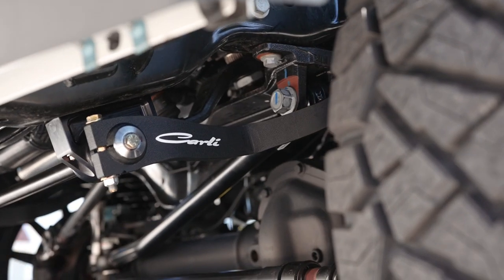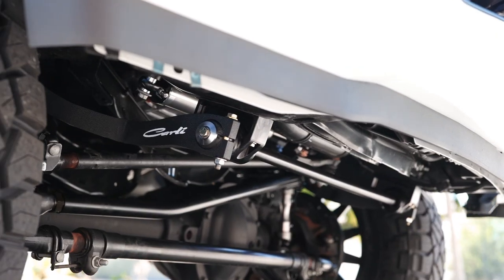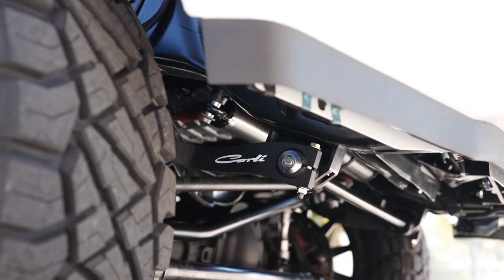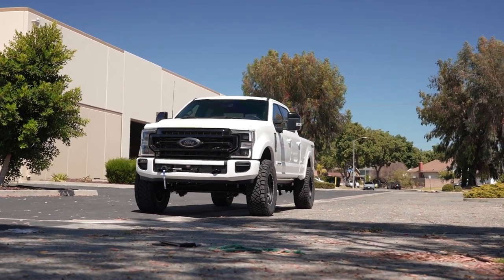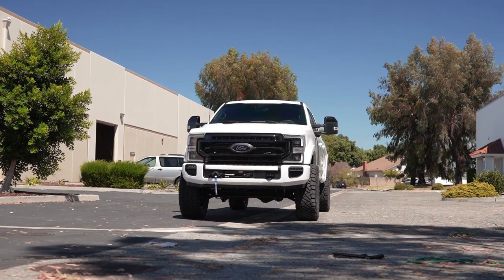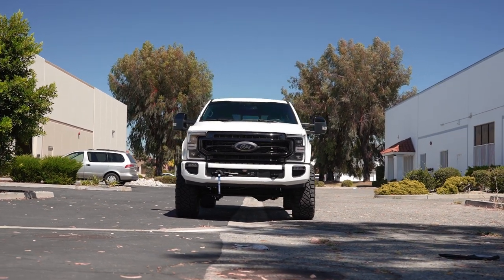The torsion sway bar you will see is an upgraded sway bar. Typically people in the car world upgrade their sway bars to a stiffer bar for better cornering. We're actually going with a slightly lighter rate sway bar. That's going to cut down a lot of the in-cab feel you get from driveways and one-sided hits, yet the sway bar is still stiff enough to allow you to really drive this truck like a sports car without crazy body roll. So it really is a happy medium.